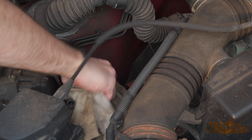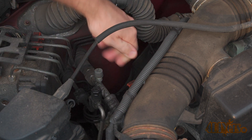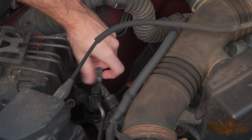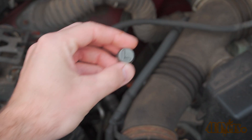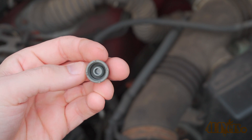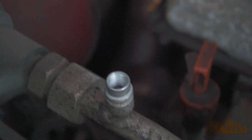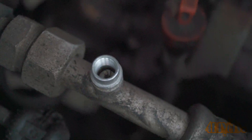First is adding a dye to the system — this will help pinpoint the leak. The system is filled through the low pressure port side on the AC system, which is found under the hood. It's a smaller port and should be labeled with a cap, which may be labeled with an L meaning low pressure side. Inside there is a Schrader valve; you'll need a special tool to fill up the system.